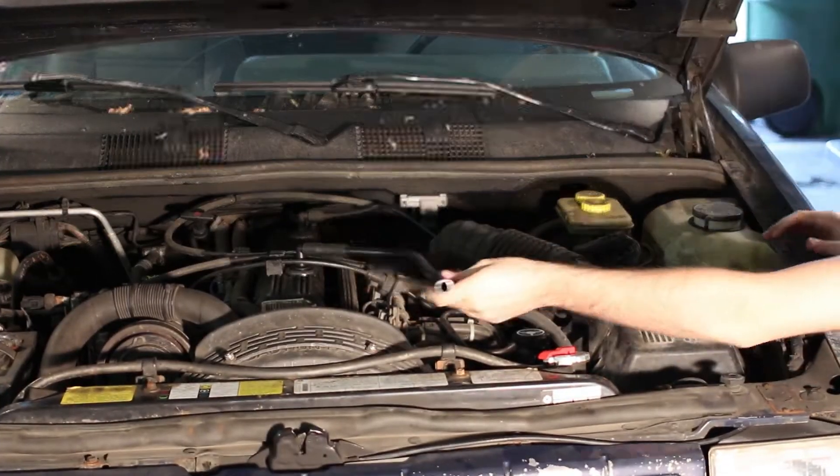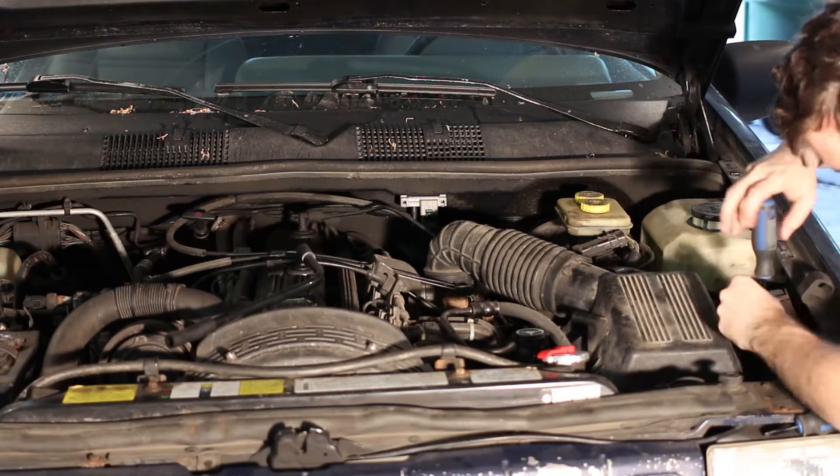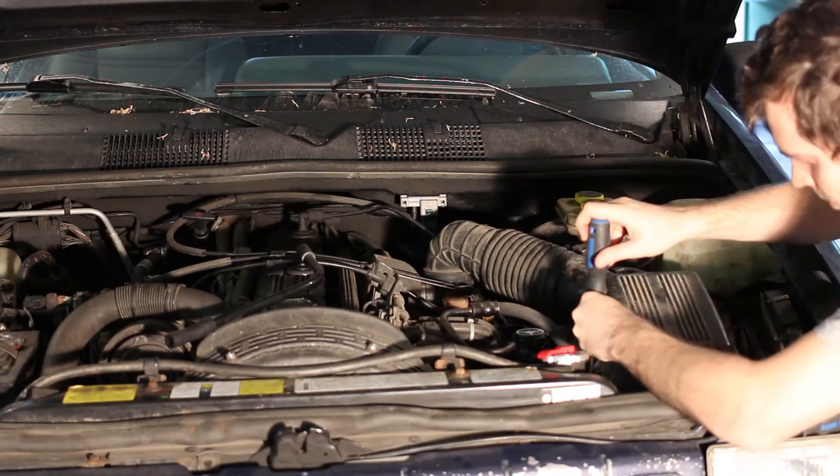It's nice and shiny, which is great — everybody loves shiny new parts. First things first: pull the valve cover breather and vapor canister hose off and place them aside. Next, remove the air intake tubing, the filter, and the air box.